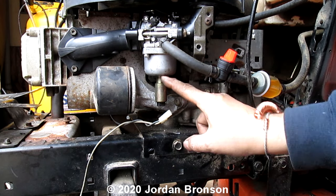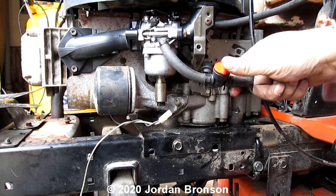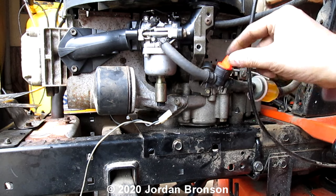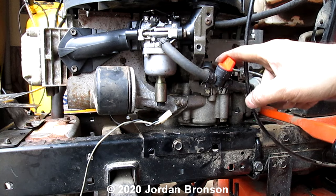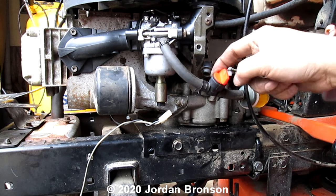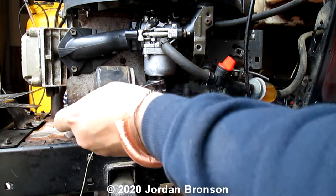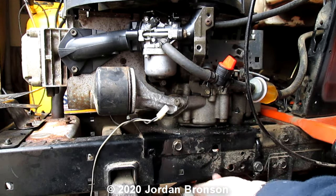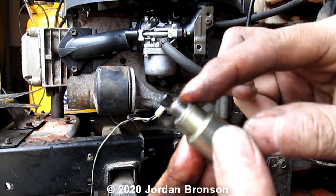If you run into this problem, a lot of people actually bypass it. But before you bypass, you always want to shut off the valve, because now we are actually going to manual. And remember this, in the winter you want to shut this down, and that's why a lot of people forget. So the tip is, if you are going to bypass this, you need to shut this off, because we're turning it to manual. This is going to be a manual shut off. And today, it's really easy. There's a needle inside, and you need a 1/2 inch or whatever fits into this, and it will turn out just like that. Remember, fuel is going to leak out because we're going to bypass this. I'm going to bring it really close. That's what we're talking about right here.